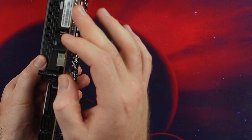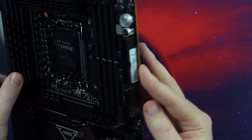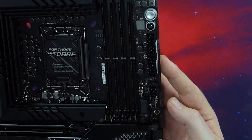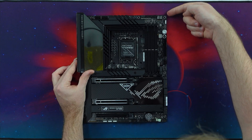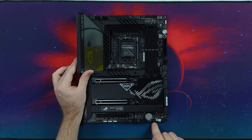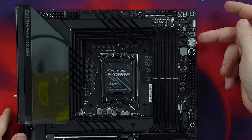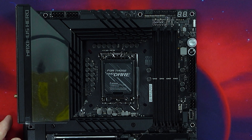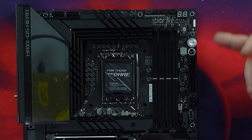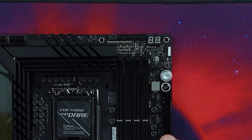On the side, just running through: you do have your six SATA ports. You do have plenty of USB 3.2 probably Gen 2 headers down there. You have plenty of fan connectors — you have four right up there, and then around eight total in that area. And then you have a bunch of different connectors — you have your RGB, and also your start button, your FlexKey button right there, some of your post codes, a reset button, your post code display, and your post LEDs right there.